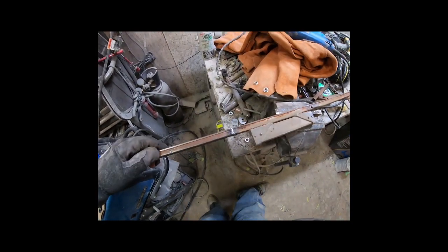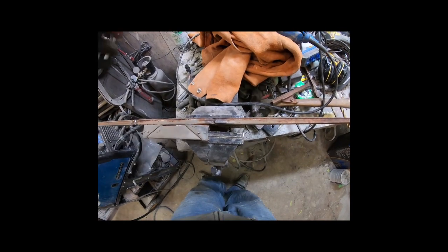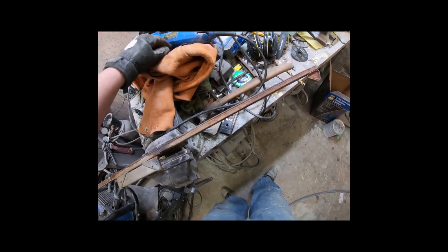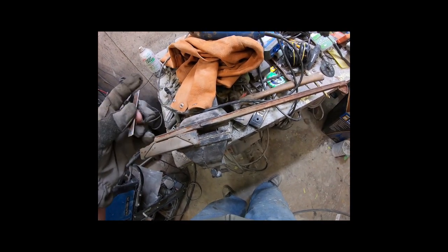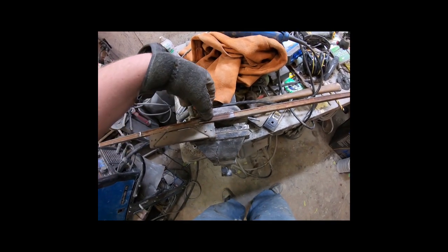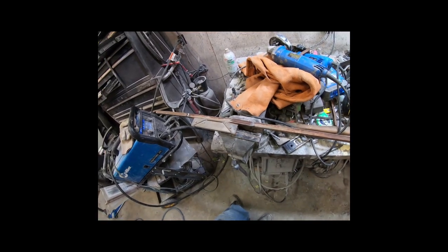Here's where I ended up — I got that piece rolling on as best as I can. It's got a bit of a wobble in it but I'll hammer that out after. I took a section, cut it right down the center, and split it in half, so I end up with two pieces like that. Then I just ground down a little bit on the wheel. I plan on putting one on each side kind of like this — I'll weld that on both sides, it'll go kind of halfway around, and I should be able to join those up and it'll be good as new.